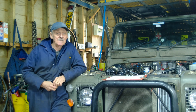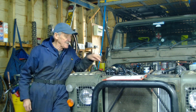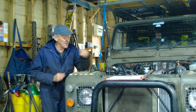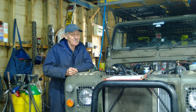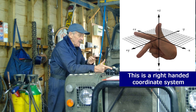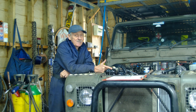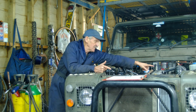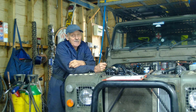The first step is to establish the geometry. The easiest way is to set up a coordinate system and measure everything with respect to that. I'm going to have my origin directly above where the lower support point is going to be, with my x-axis along there, y-axis going backwards, and z-axis in the vertical direction. I measure all of the key dimensions against this — in particular, the position of the hinges, the lower and upper position of the support when the bonnet's in the closed position, and all of the bonnet key dimensions.